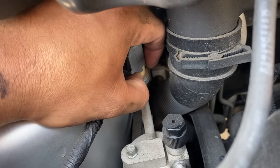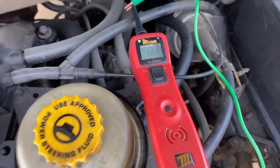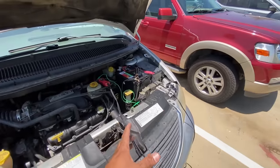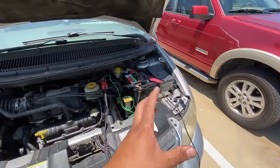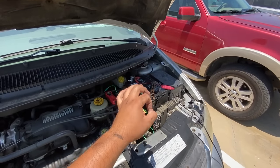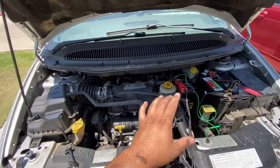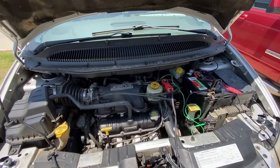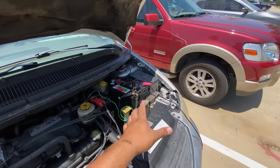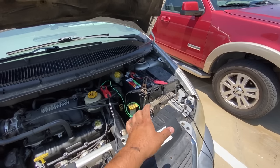That made absolutely no change at all. It's looking more and more like we have a bad PCM. We've checked our main powers and grounds — they're all getting to the PCM — however the PCM is not outputting a 5-volt reference signal. This thing definitely looks like a dud. There is a very small possibility that the 5-volt reference is being shorted in the wiring rather than a shorted sensor, so that's the only theory keeping me from telling the customer they need a new computer right now. I'm about 95% sure, but that 5% can bite you, so we're going to verify the circuit isn't shorted.